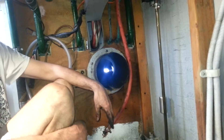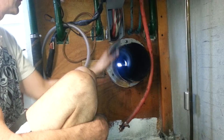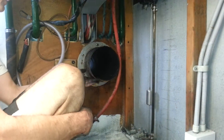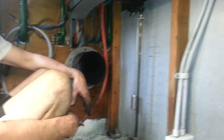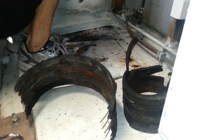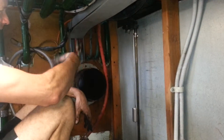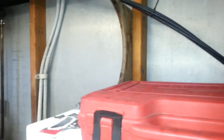You can see out to the back of them? Yeah, you can see right through out to the exhaust ports out there. There's a little bit of pitting in this one — it's not too bad actually. But there's quite a bit of corrosion and pitting in the muffler, and the muffler's actually leaking. So we'll have a look at whether that can be patched or whether we just dice it and make a new one. In the meantime, I'll clean this all up and start putting the new exhaust pipe on — at least that's one bit out of the way.